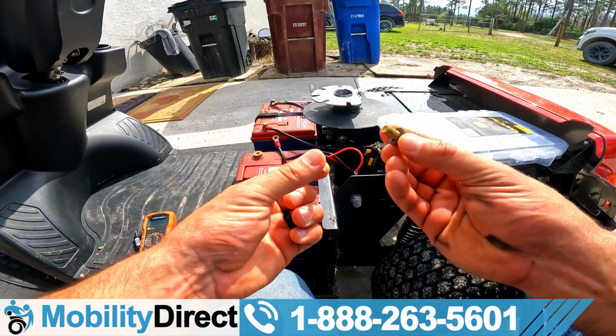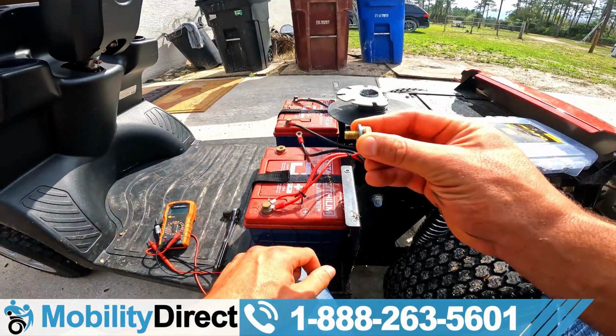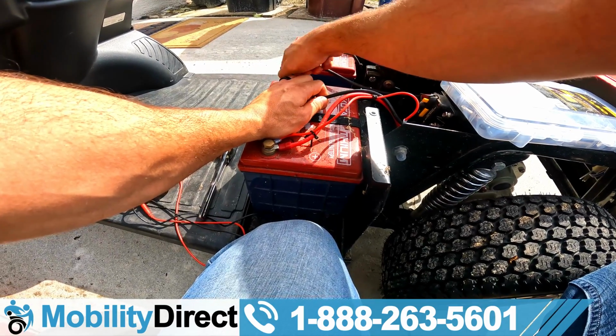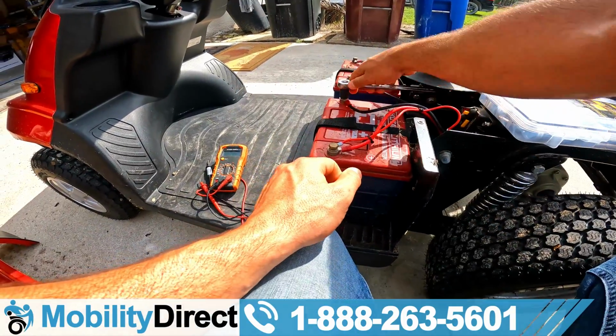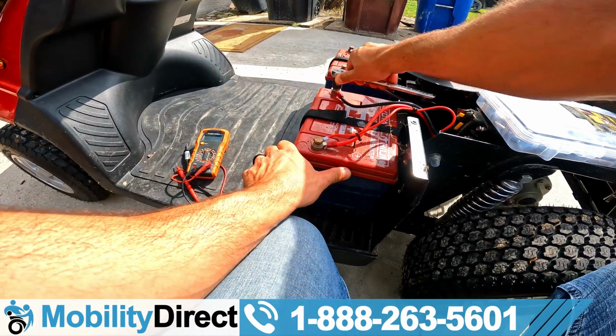So what I'm doing is I'm putting an extra washer in here. That was the problem. These bolts are not the original bolts that the unit comes with. So I'm gonna have to modify it a little bit and improvise. That's okay. It's just a washer. We just wanna make sure that that bolt is nice and tight and that it's not wiggling around, because this is an off-road scooter. So when it's shaking around like that, guess what?